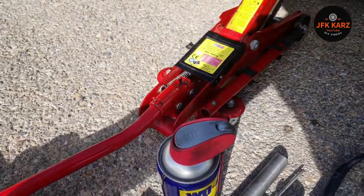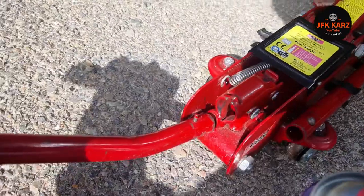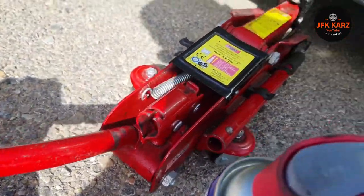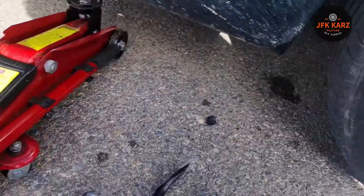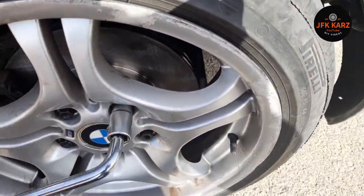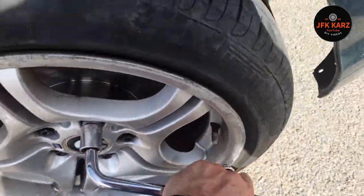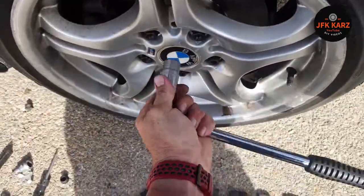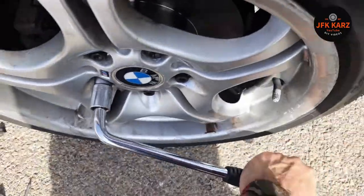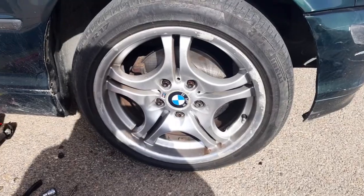Now we can let the car down and torque it up — I think it's about 120 newton-metres if you want to get technical. Using my jack, that's where this little button comes in handy, so the wrench goes on there. You don't want to forget this bit — tighten your wheel nuts right up to the required amount, which is about 120 newton-metres, or just as tight as you can so you know that's not going to go anywhere. Thanks for watching and see you in the next tip.